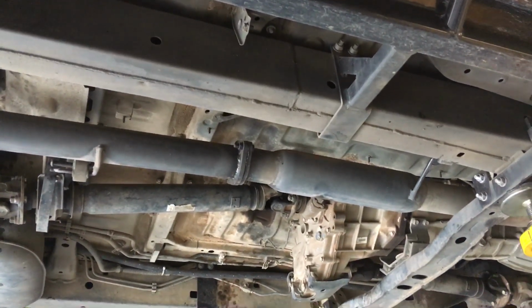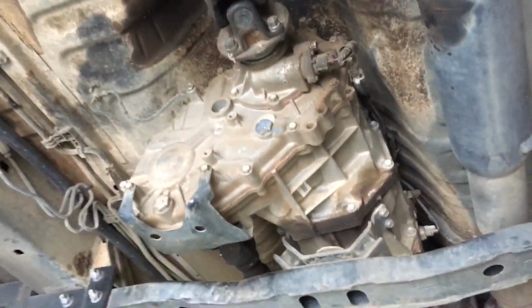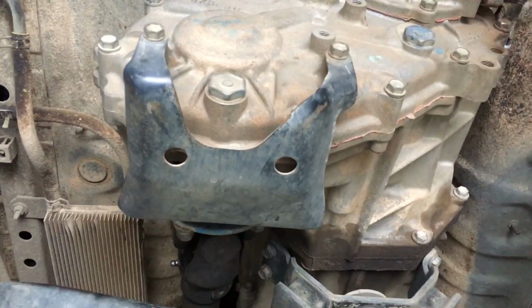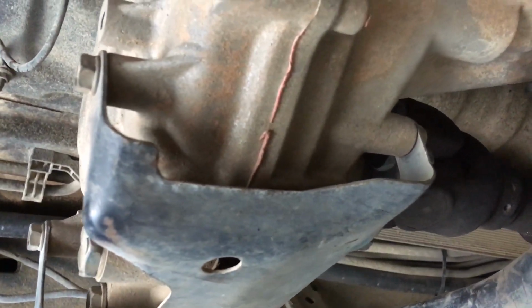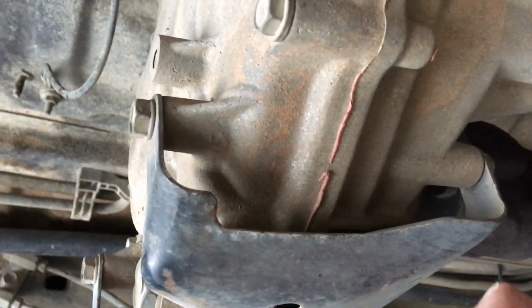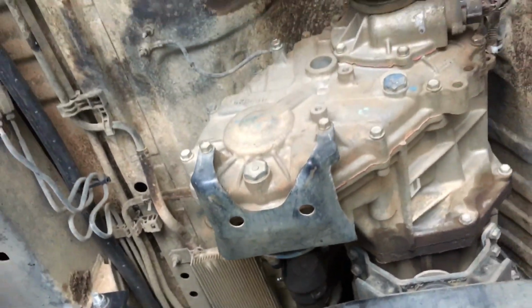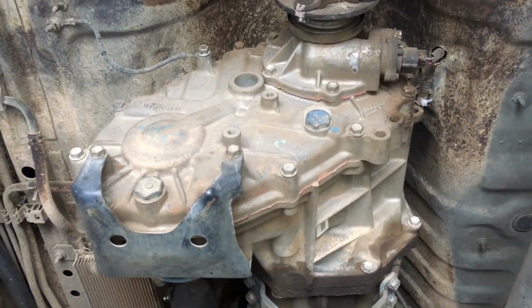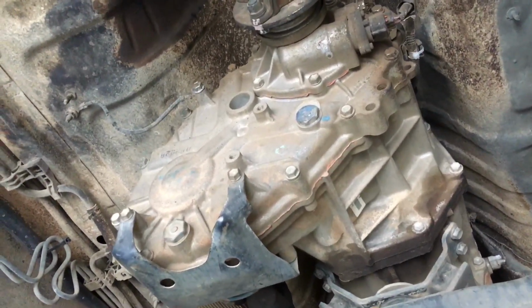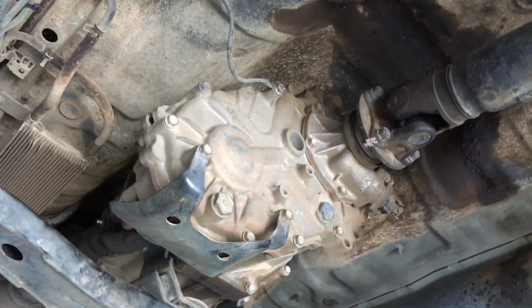And so the question is, and it's not from KUN, this is from me, when we service these vehicles, this one's all right, but we often see that transfer case there. You can see the transfer case, see the little black guard over it. I have seen these, not that I see much anymore because I don't really service Hiluxes anymore. They all get pressed in and mashed around. So you get a lot of action, if you like, on the tracks that hits that. Obviously you don't want to hit the transfer case with a big rock because it could crack it. You don't want a big heavy duty guard that mounts to the transfer case because that'll create leverage and crack it, like what happens on the Prados with that design.